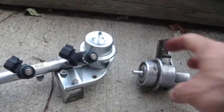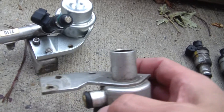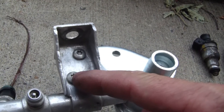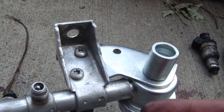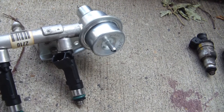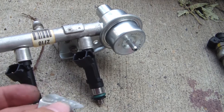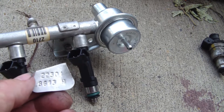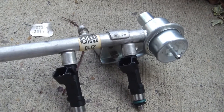Check out the old pressure regulator. There are Torx screws — make sure you have Torx bits. It was a small one, I think a T3 or something. There are a few Torx screws holding the fuel rail, so make sure you have those bits handy. I also noticed there was a tamper tag when I took off the fuel pressure regulator — I guess when you see it's not there, somebody has messed with it. I didn't bother putting that back on.